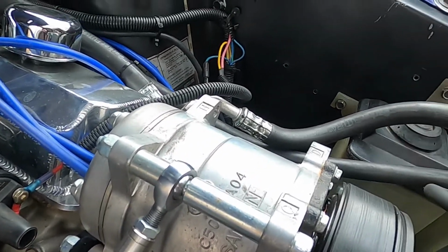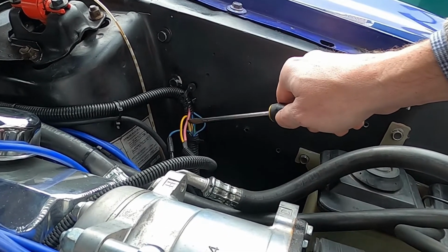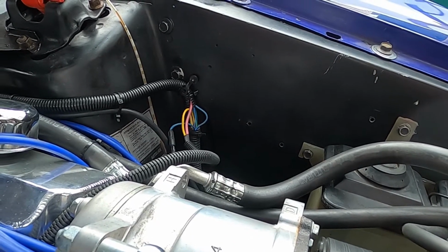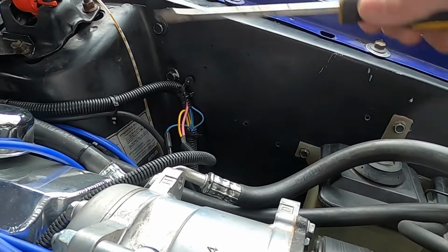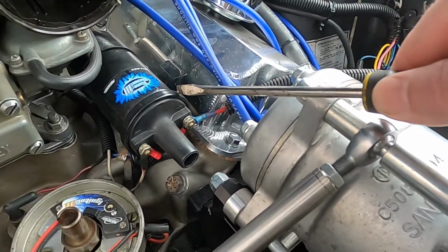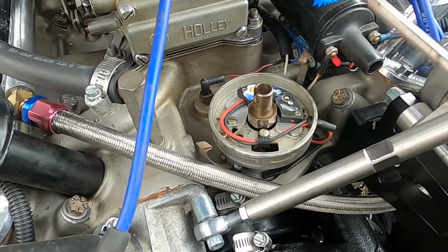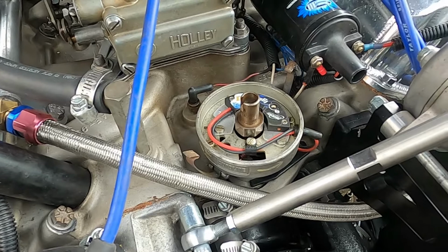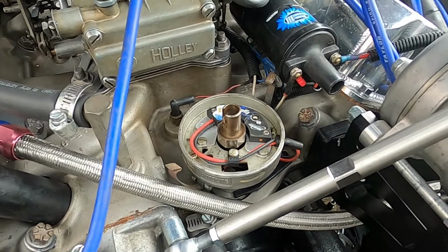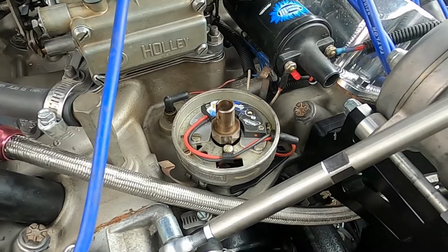When the ignition is just running and you're not operating the starter, this pink resistor wire, the dreaded pink resistor wire on the stock harness, actually is designed to reduce the voltage through the system from 12, where it starts on the pink wire, to about 6 as it comes through on the coil. So it's actually running on 6 volts. That's because the points ignition can't handle 12 volts constantly. You'll burn out your points. And that's why these cars start on 12 volts, so that you get a good strong spark initially to get it to start up, and then run on 6 volts.